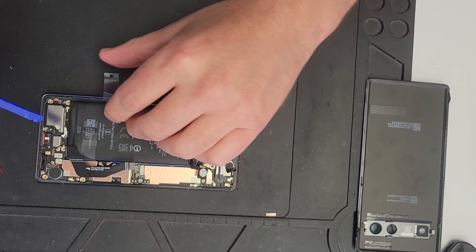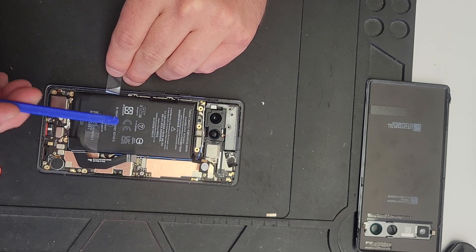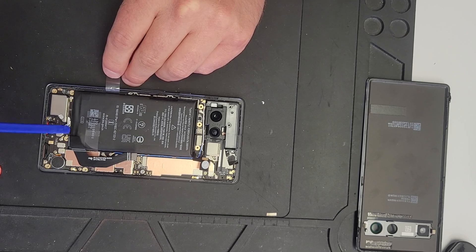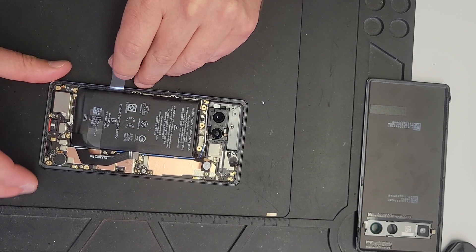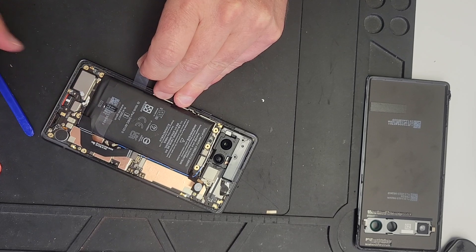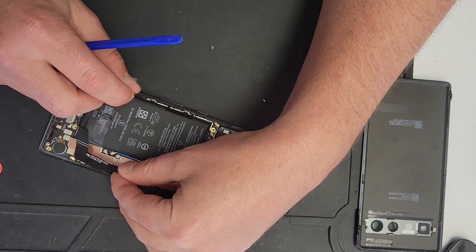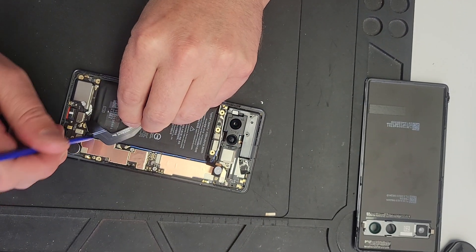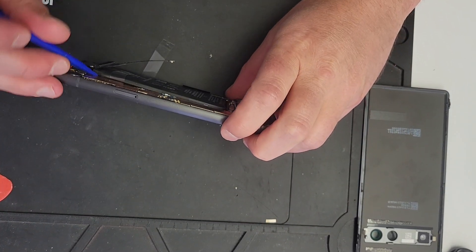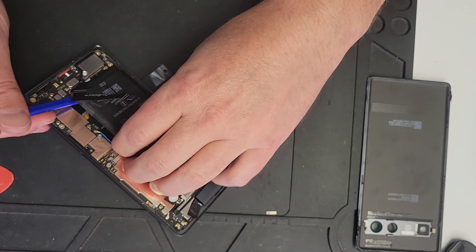You can take the battery off now. Apply a little bit of heat to the front, but not enough to burn the LCD — under 100 degrees Celsius. If you use a heat pad, that's fine as well. Or you can use some isopropyl to loosen the adhesive. The battery usually sits on top, so just loosen that up. You can pull on the tab to get it off, which is what they're meant for, or loosen it up that way. Then pop it off like so.